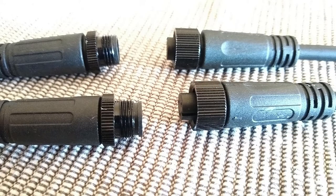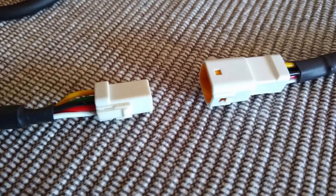The connectors for the spotlights are 3-pin, push-in and screwed together — definitely secure. The connector for the multi-function switch is a simple 6-pin push and latching affair, which also seems well secure when connected.